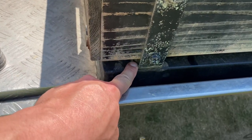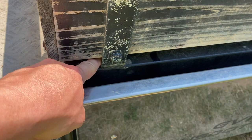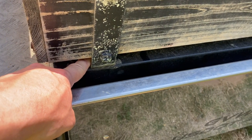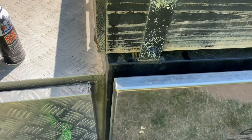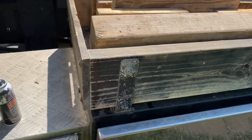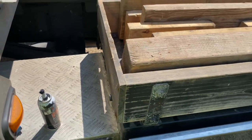When I bolted it into the actual toolbox, I definitely RTV'd it heavily, and then after that dried, I threw some Rhino liner on it just to make sure I didn't get no water coming inside of my toolbox. So after that was sealed from the top and the bottom, I went ahead and just drilled out the bolt holes and just used a standard hardware kit to brace in those 2x6s in that 1x. And it came out pretty good.